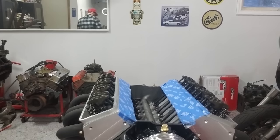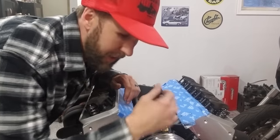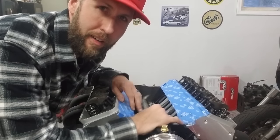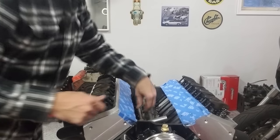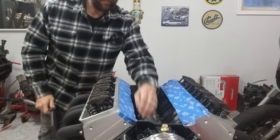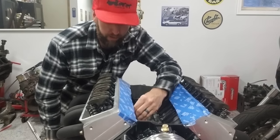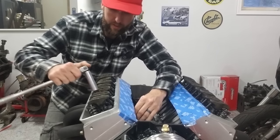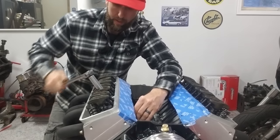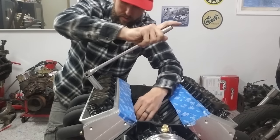Now I'm going to show you that it literally doesn't matter. I can come back to it. I'm going to roll the motor — let's just say I rolled it 90 degrees. I usually do 90 degrees at a time, so I just grab the harmonic balancer and roll it over. Now I come down the same ones that I did and check if any are loose. See how this one's tight, this one's tight — but this one's loose again. So I come back in and adjust it until it's tight again, just like before.